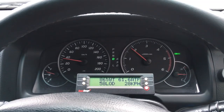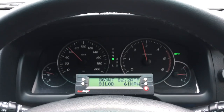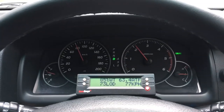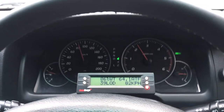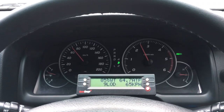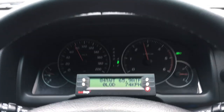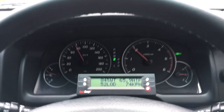Just accelerating — I'd guess that's probably third. If I accelerate more, see the revs go up; I back off and the revs drop. It's gone to fourth. Watch as I accelerate and back off — see how the revs vary? That's the torque converter slipping. You can speed up and slow down. If I hold it back in third — as I accelerate, the revs go up fast, and when I back off, they drop fast. It's not locked — that's your torque converter slipping.